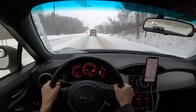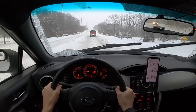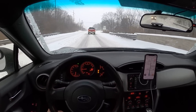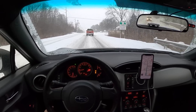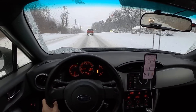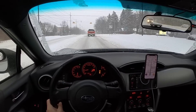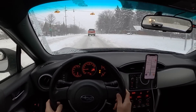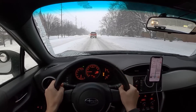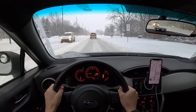My recommendation, if you are driving your BRZ in the winter, would be to get a set of taller tires. You can probably get away with at least one size up — 205/50/17s or 205/55/17s might be the best option to go with the stock wheels. Something that's just about an inch taller than the stock tire diameter. That'll give you an extra half inch of ground clearance, which I think would be just perfect and right along the lines of most other vehicles plowing through unplowed roads.